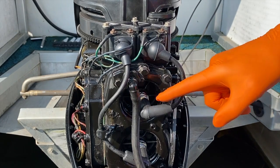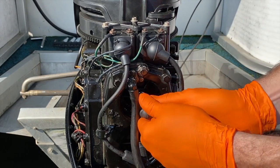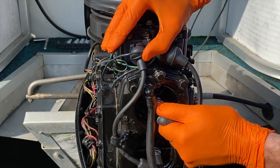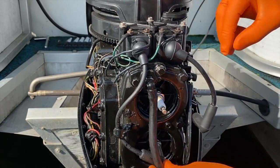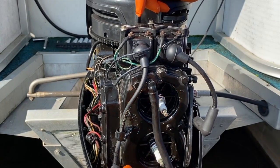I'm going to remove both spark plug boots from the plugs themselves, then remove the actual plugs. Carefully grab the boot — not the wire — and remove it. Going down below to remove this one as well, then set that aside.